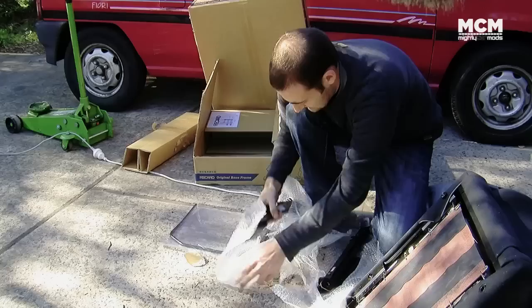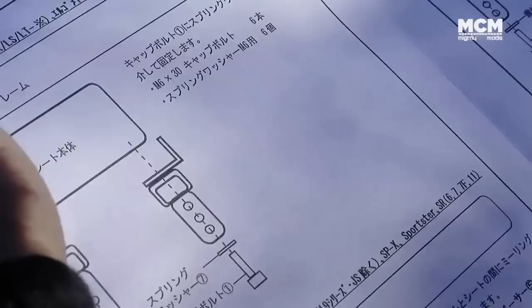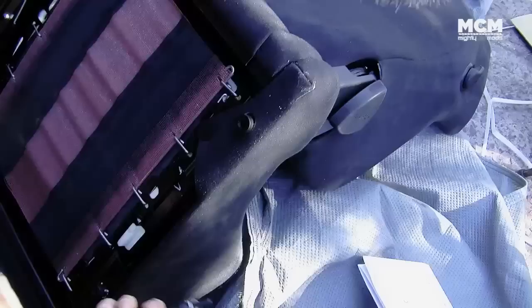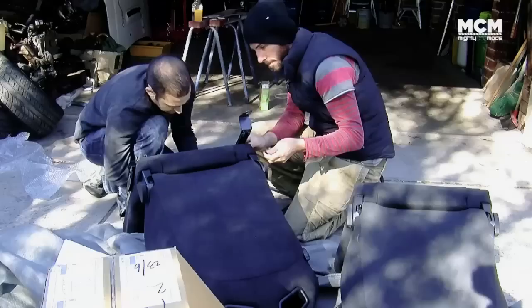First, jack up your car. These base frames are pre-made to fit both the floor plan of the car and the seat's mounting system. The first step is to attach the rails to the bottom of the seats. All our instructions were in Japanese, but the diagrams and the odd English word was enough to get an idea of what goes where. The rails come supplied with all the appropriate bolts and hex keys. You'll need to slide the rails back and forth in order to get all the bolts in — a screwdriver can be used to release the slider lock.